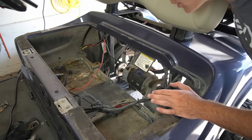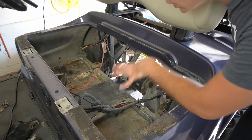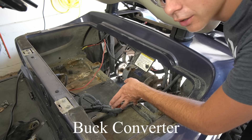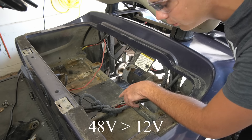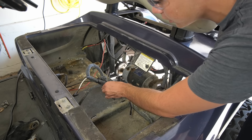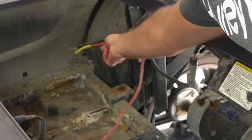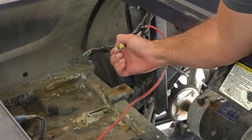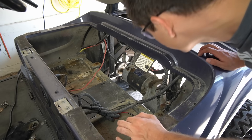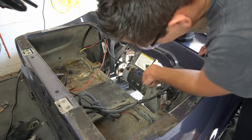Now that the batteries are gone, we have the main positive over there and the main negative over here. So we just need to throw in a lithium battery and add a buck converter, or step-down converter. That'll take the 48-volt voltage and drop it down to 12 volts so we can run our 12-volt circuit. I also need to redo this charger connection line — the crimp connection is horribly done. So I'm going to rewire all of this. We have the main on/off switch and the motor down there with a little gearbox.